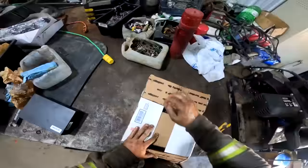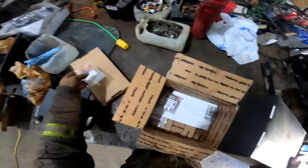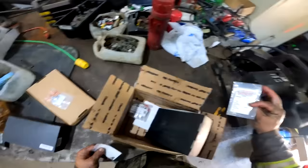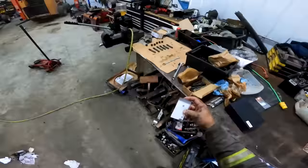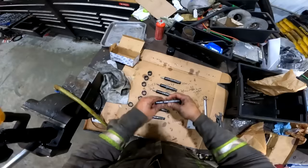So like I was saying earlier, I love Power Driven Diesel. They're minty, as they sent me an injector shim kit and this, that, and the other. Bought this a long time ago in the name of trying to get more fuel economy out of the old Ford. Yeah, this is that AFC Live thing. I haven't put that in yet. And we got injector shims, so we're just gonna go ahead and shim these two up so they pop at 3,500.